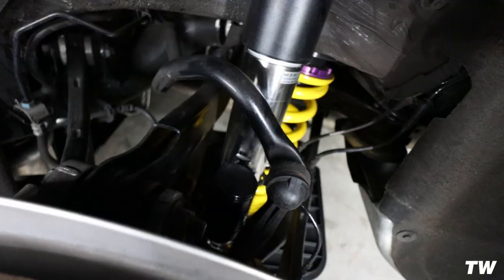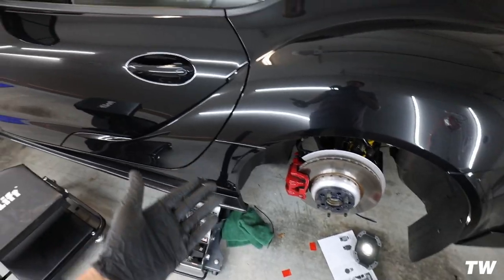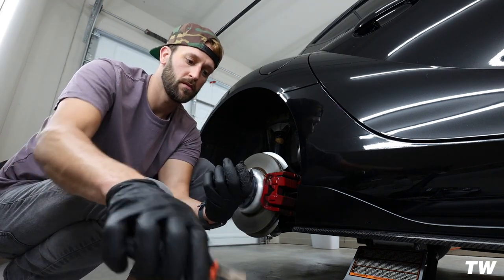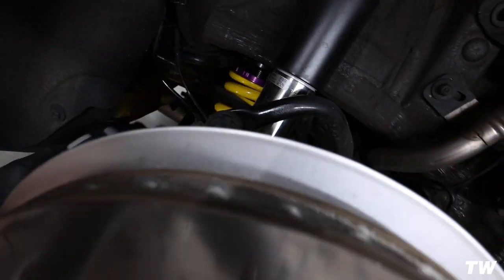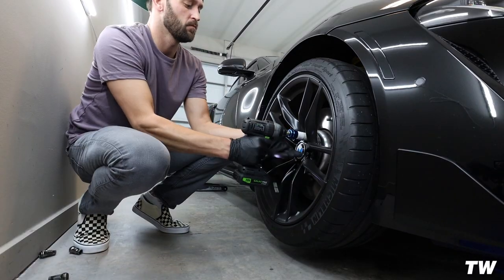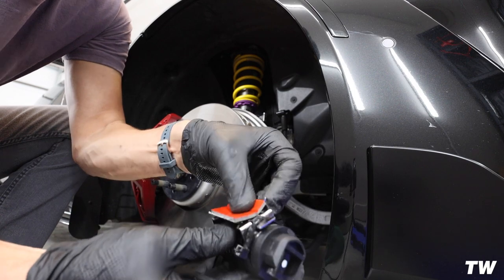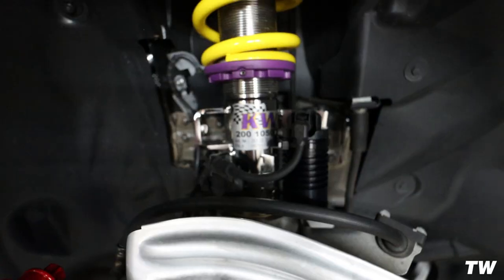Everything looks good. I tried doing it with the bracket on the shock assembly first and then working in there — not the way to do it. Definitely a lot easier to assemble it outside of the car. You can probably do this for the front too: assemble it, zip tie it, apply the 3M, and then put the whole unit onto the shock assembly. That seems to be the easiest way, because you really don't have much room to work with back here and this is the only place it's supposed to go. So we'll do the other sides now that I know how, then fire up the car and hopefully we're all good.